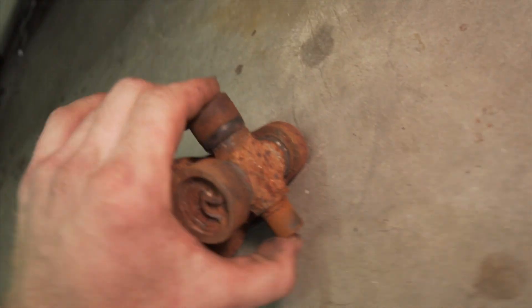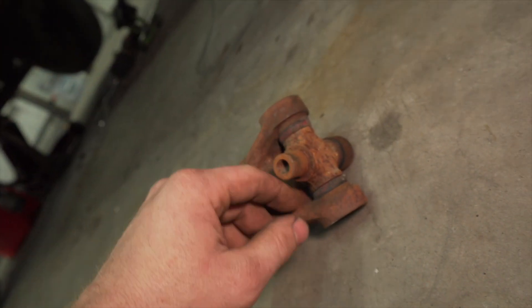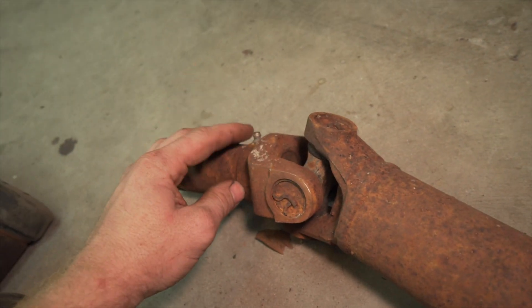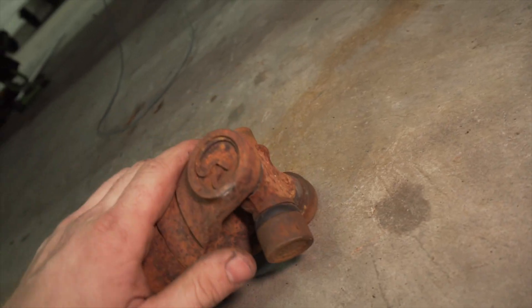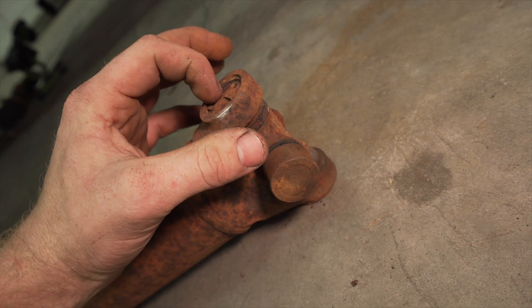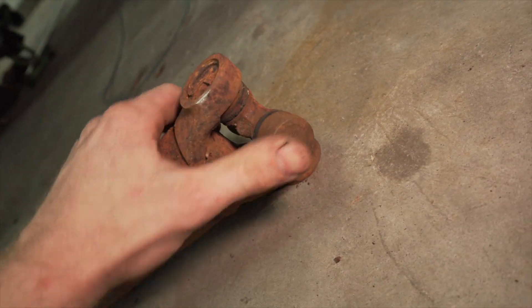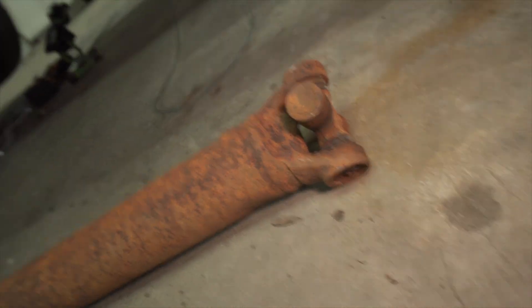I went and got the driveshaft from the barn. The u-joint over here is a little rough but these caps are good, and this u-joint is actually more than okay — it's pretty good. I'll probably grease that after the fact. Unfortunately none of these u-joints are greasable — I have to put grease in the caps before I put them on. These ones here are kind of toast but until I actually press them out and put new u-joints in, it is what it is. It's going to work for right now — these aren't going to blow up on me. I'll run these for a little bit until I get this thing reliably on the road.